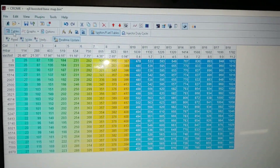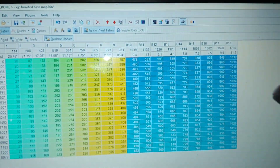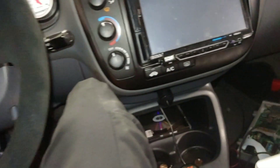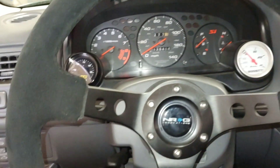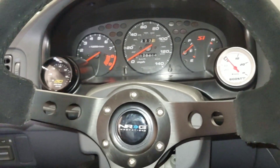All I've done is add 10% in all the boost columns — in low no-VTEC and in VTEC I added 10% in boost across the board. So let's go for a little drive and see if we can get closer to 11 AFR instead of floating around in the mid-12s. It's a little lean. I don't have a whole lot of time to make adjustments because the car does have a blown head gasket.